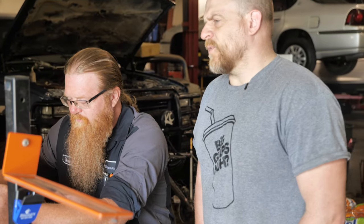Okay, good. What kind of O2 did we put in that? I put a GM one. It was actually an AC Delco. You had mentioned they changed the O2, she thought, because they did it once under warranty. When I looked under Advance's site, it said Denso is the OE. I told my commercial guy, you're showing an AC Delco in your World Pack line, which is usually a brown box, but you open it and it's like a Toyota part or a GM part. And it said AC Delco. Okay, so maybe the lesson there is aftermarket O2s.